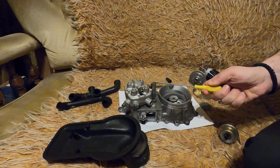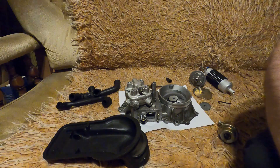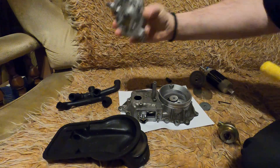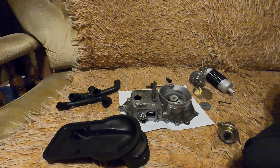My firm attitude is that on this seal screw, no adjustment can be done concerning the idle — to raise it or to lower it. No, that's absolutely not possible. That's something that is done on the ICV itself. Now we're talking about K-Jetronic.